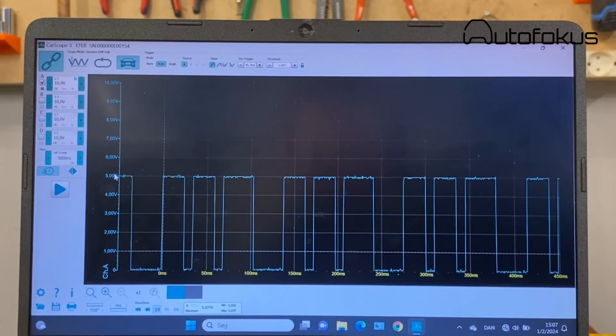The oscilloscope has now been connected to the signal wire from the hall sensor, and this is what the signal looks like. As I said, it's either off or it's on, and this particular sensor has an output of 5 volts. This is basically just what it looks like. I'm using an oscilloscope so you can see the signal, but also because it is a camshaft — it rotates too fast. If it had been a wheel speed sensor, you could actually connect a voltmeter to it and just rotate the wheel slowly, and you would also be able to capture the signal.